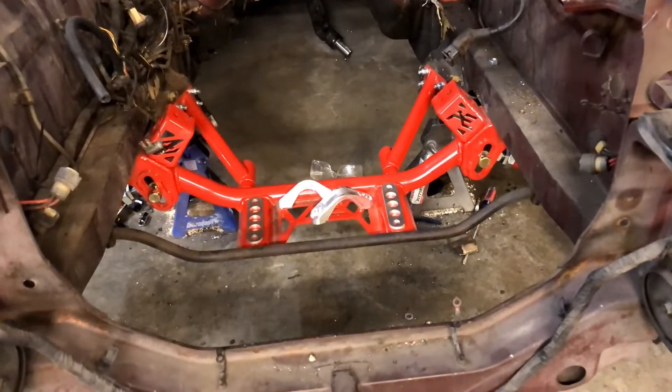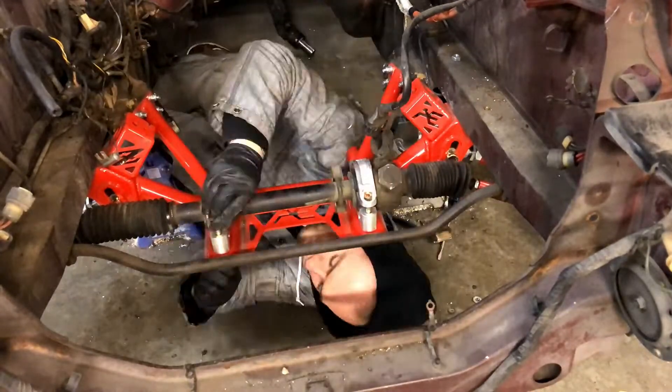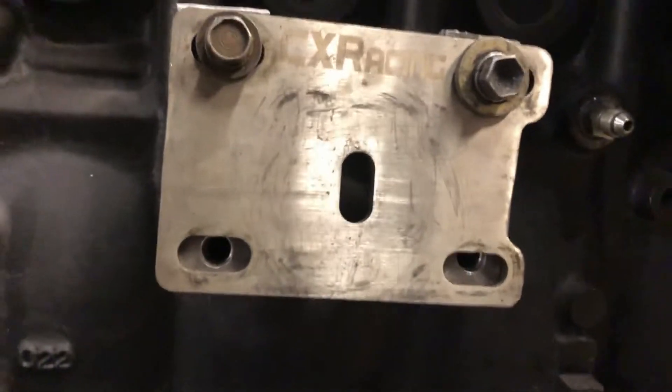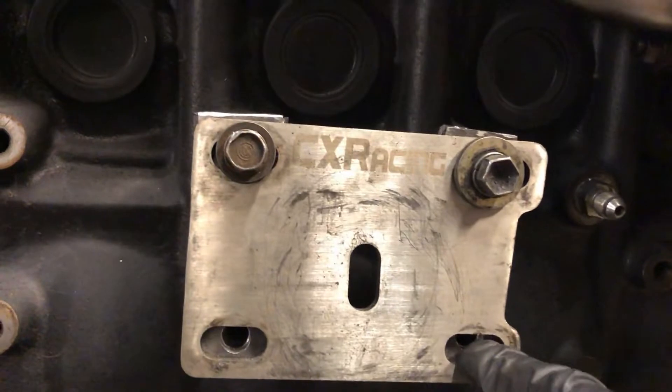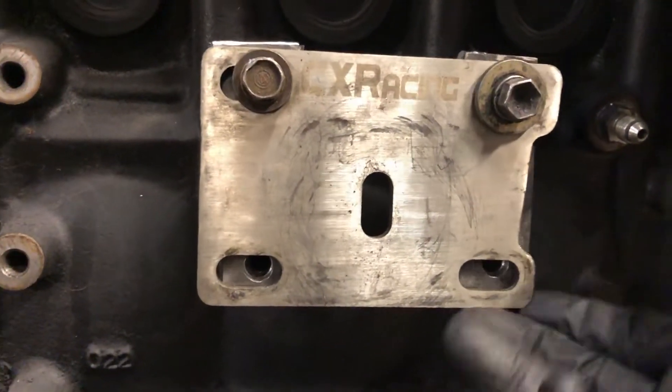One week later. What's up guys, back out here. I'm finishing up the cross member. The only thing left to do is put in my steering rack. Once the steering rack's in there, we'll finish up the brackets for the 2JZ and hopefully get it in there. I went to test fit the brackets and this lower right one I messed up on — I just have to drill it further down to get the bolt to fit. We're gonna re-drill and slot this one further down.